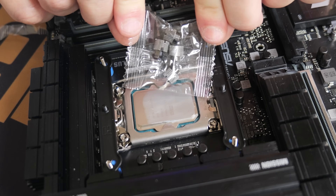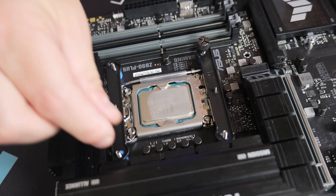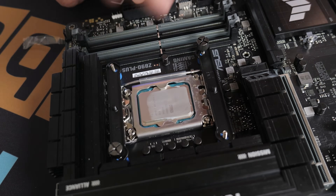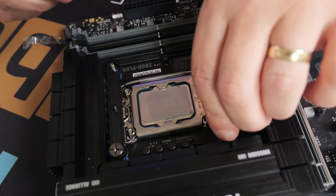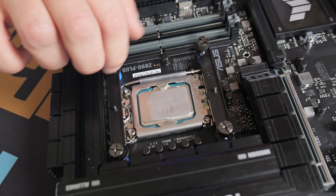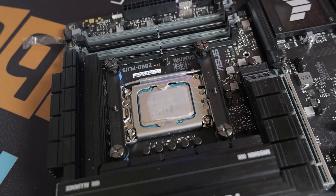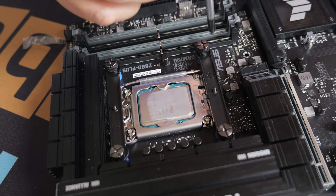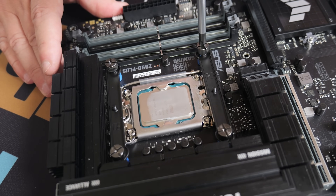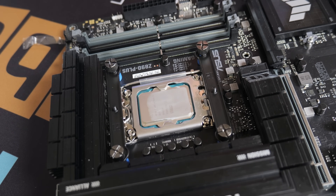Next grab parts bag J, which has the thumb screws. The thumb screws just go over the top of the four pillars. There doesn't have to be any particular order for which ones you put on first. They will all need to be tightened up until they go right to the very bottom. I would certainly suggest, even though they are thumb screws, they do have a crosshead design so you can use a screwdriver to get the correct torque. You'll notice they will go down quite a bit further with a screwdriver. I would do opposing sides to make sure the backplate is completely flat. The plastics are pretty rigid so there isn't a lot of give. That is the bracket and motherboard setup.